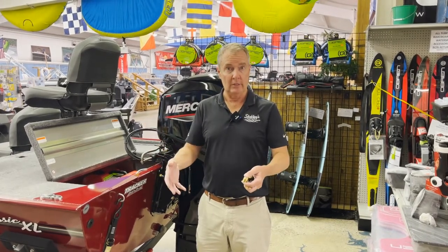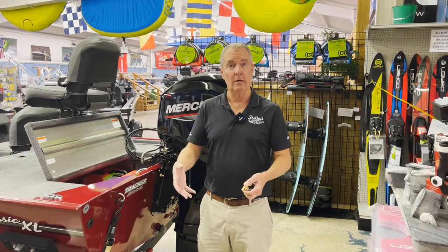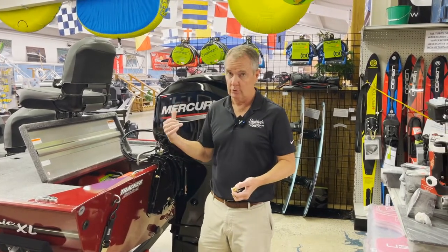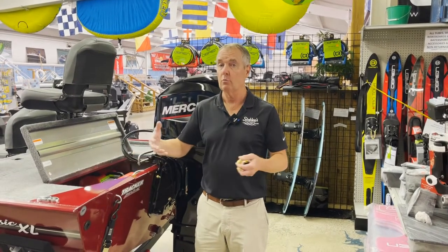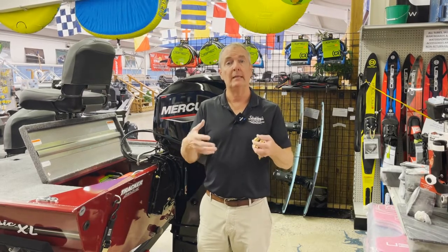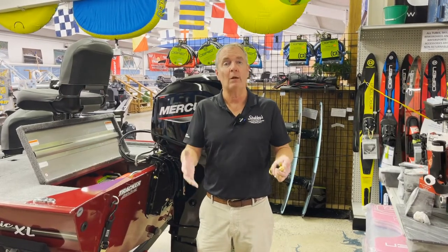If you've got an oil injected motor and it's got an oil tank in the boat, it can get in your oil tank. It can ruin your oil. Even worse, it can ruin your engine. If it even goes high enough on an inboard outboard, a Yamaha jet boat with an inboard engine, a Mercruiser or a Volvo with an inboard engine, you can get water up around your engine, and even one that's been winterized, it can take water into your oil cavities and you can still crack an engine and do damage.